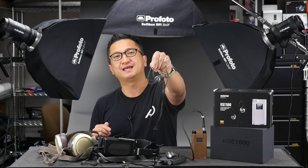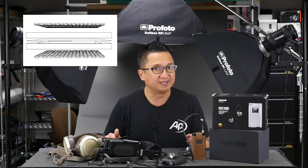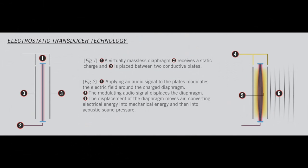Let's take a closer look at the Shure KSE 1500. For those of you not familiar with electrostatic headphones, here's a quick abbreviated description of what makes them different. Electrostatic drivers use a flat, super-thin diaphragm drawn taut like a drum skin and suspended between two conductive perforated plates called stators. That super-thin diaphragm has a fixed or static electric charge. The audio signal is applied across the two stators — the signal in one stator opposite in polarity to the other — so when one's pushing the diaphragm, the other's pulling, all uniformly over the diaphragm's entire surface.